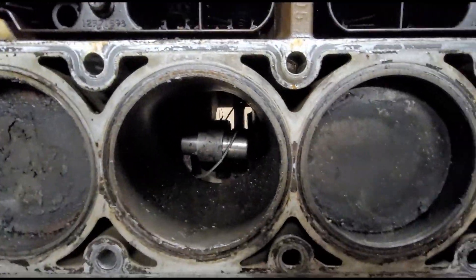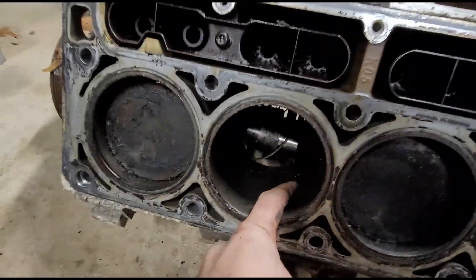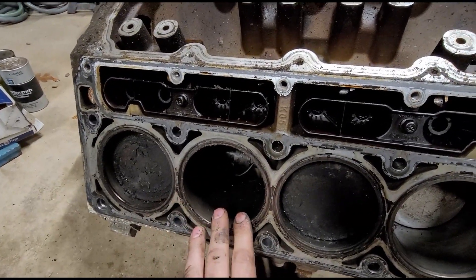Taking a quick look here — there's that problem child. It doesn't really look like it hurt the cylinder too bad, but it's got a big gouge and a couple of gouges in it, so if I wanted to use this engine I'd have to get it resleeved. I was thinking about turning it into a table — I already have an old multi-port fuel injection 3-1 with a piece of glass on top with pistons and connecting rods as the legs. I really wanted to use it for the Trans Am sitting outside to work on with my daughter, but it might not be worth resleeving when I could just pick up a 5.3 at the junkyard. Anyway, let's get the other engine apart, set the heads side by side, and see what everything looks like.